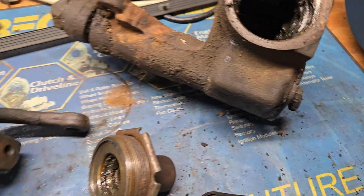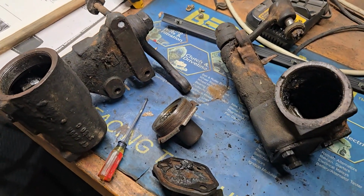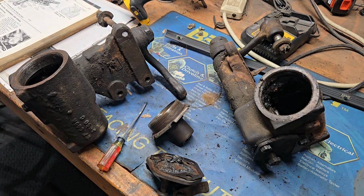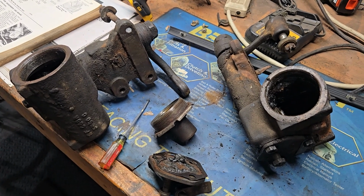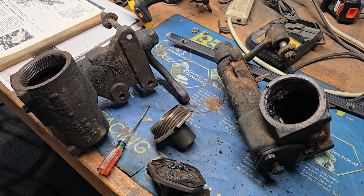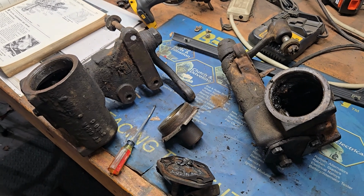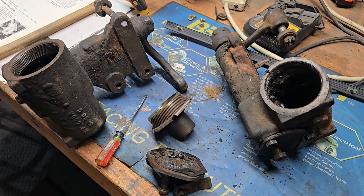The steering box in my car, which started this whole escapade, would catch and not return after making a turn. And it was not an alignment problem. I thought maybe that was it, but after having an alignment performed, it did not fix it. Caster was fine. So what I did was I figured, well, it can't hurt to grease it before I pull it out and throw it away. And I pumped it full of grease, and within a few miles, it actually started to free up, and it's been pretty good ever since. The only problem now is I'm finding out that it is very loose on center. It's worn. It's got 124,000 miles on it, and a lot of that was without grease.